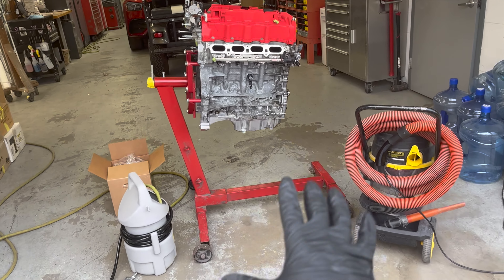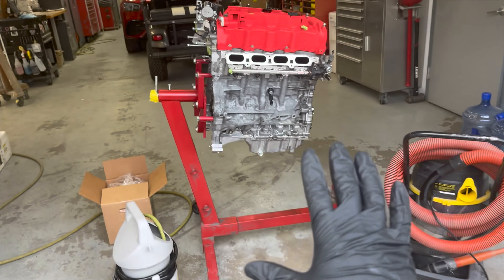With a claimed mileage of only 38,000 miles, if you check these intake runners, you'll see all of these intake valves have some pretty severe carbon buildup. Pretty much all turbo direct-injected motors are going to have issues with carbon buildup. Signs of premature carbon buildup — the two biggest causes are A, not doing frequent enough oil changes, and B, running cheap gas.